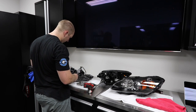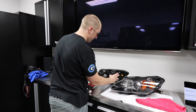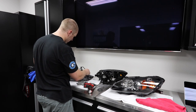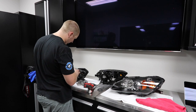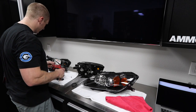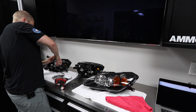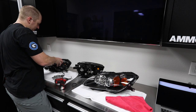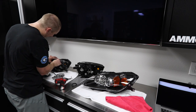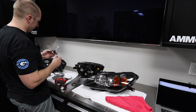So that Molex plug comes off, so we can come up through the light. All right, we're going to reuse this rubber grommet. So we'll need this piece here. All of this. So I need a Torx bit. T25. Bingo. I've always been a huge fan of these headlights. How they look. They do flash other people though, when you're driving around. Cool, super easy.